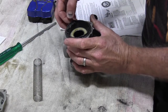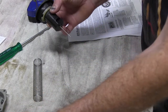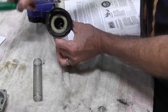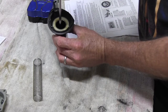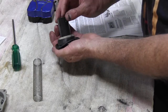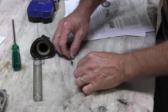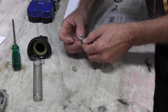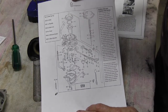Release the diaphragm for the piston and the needle comes out with that. Down the middle of the piston there's a Phillips head screw — just go a third of a turn and pop that little clip off, and the needle will slide out. Take note of what order everything's in: we've got the little cap and then a couple of little shims on the needle that are lifting it up, making it richer.